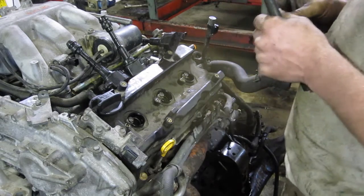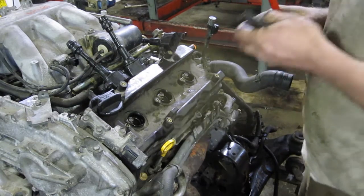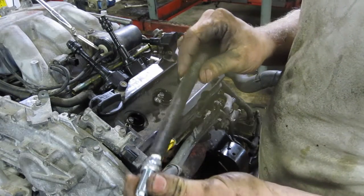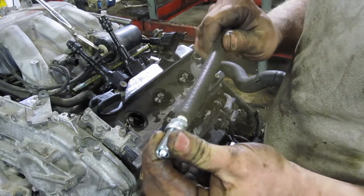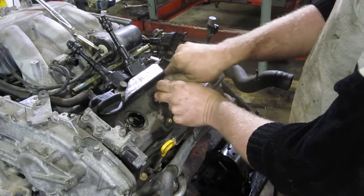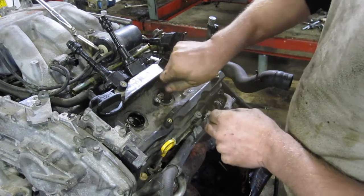That leaves a lot of chance to strip the plug or put it in wrong. An easy way to take care of that is a simple piece of hose — just put the hose on the end of the spark plug. When you're putting it in, if you do happen to cross-thread it, all that will happen is the hose will spin on the spark plug. So you can put it in all the way, bottom it out with the hose, then simply pull the hose back off. It greatly reduces the risk of stripping the plug, and in tight spots you can bend it a little bit once it's started — a lot less chance for damage.